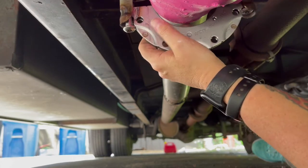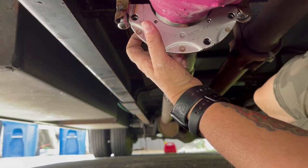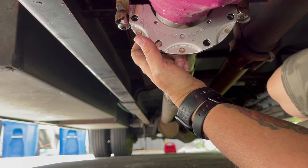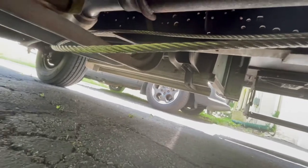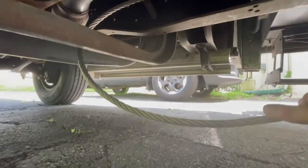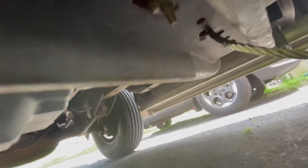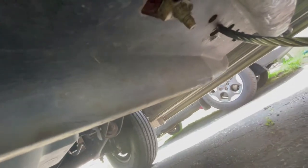Once it's actually started well, you can turn it over the proper way and bring it all the way up close to the base of the catalytic converter like the instructions tell you, and then tighten it down. The next part involves finding a secure spot on the front of the vehicle to attach this cable to — you're basically going to loop it through. In this instance I found a frame piece that has a nice hole I could thread through and go back down.